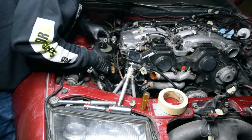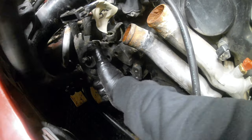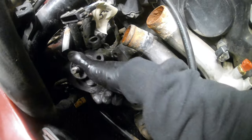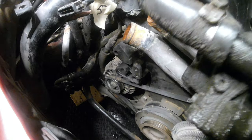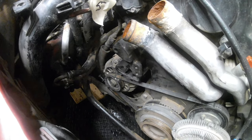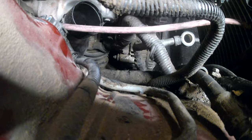Okay, now we can lift this up. Once we remove the power steering pump reservoir, you want to readjust the HICAS hose as well as the other hose to make sure you're able to pull out the power steering pump. Here it is — you can tell it's all caked up. Alright guys, you can tell the amount of room we have after removing the power steering and the power steering reservoir. It gives us a lot of room to work.